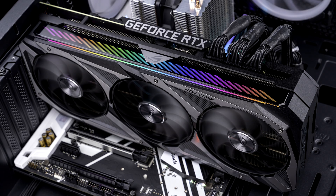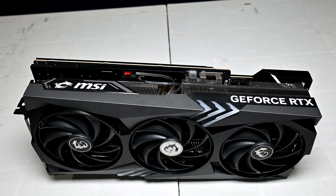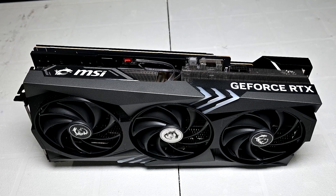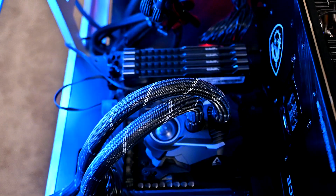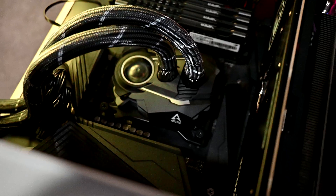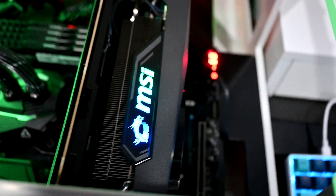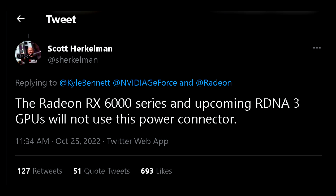This video has become longer than I had anticipated. I'm wondering what the solution will be — is Nvidia willing to ship out an updated connector? It can't happen overnight. So do you continue to use your 4090 with the potential risk of the connector melting? I don't think the customer buying custom cables is the answer. I have my 4090 on my test bench and I know CableMod sells a custom 12VHPWR cable, but what happens when I move the card to my other system with a Corsair power supply — do I have to buy another cable for that too? Just doesn't seem practical. The silver lining is that AMD have officially stated RDNA 3 won't use the new connector and will stick with the traditional 8-pin, which should help sway buyers toward their side.